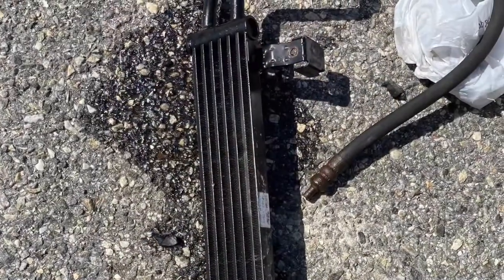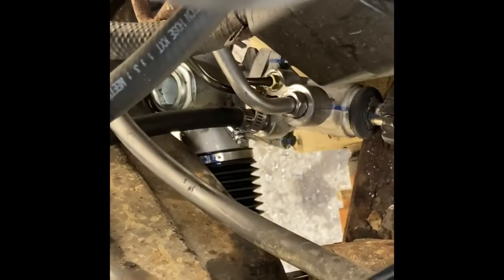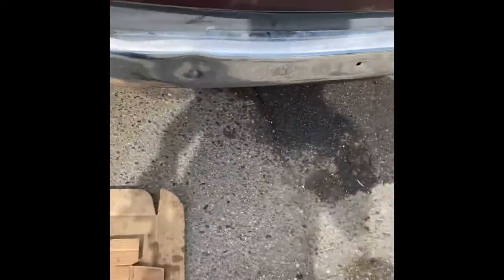Let's get it back in there. She's all buttoned back up. We had to get a new cooler because she had a hairline crack in the cooler. We got the new lines on, we have the new rack and pinion in, as you can see. Very hot day out here. We got control arms - the whole nine. Let's go ahead and throw some fluid up in there, run it, and put this one back on the road.